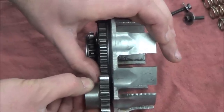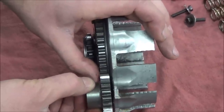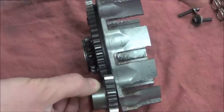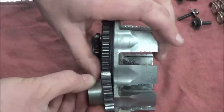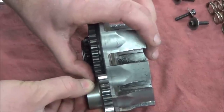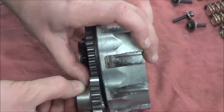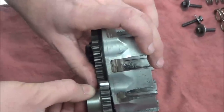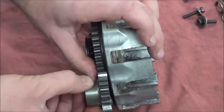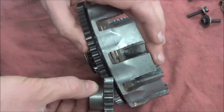Yep. Okay, so as we move into transmissions and you guys are going to be shifting those transmissions on a bench and engaging a gear set for first or second or third, you need full contact. If you just give me something like this or something like this, you understand that that is incorrect. You with me? Would a worn shift fork create one of these conditions? Yes. Yeah, absolutely. So our best friend is just go to microfiche and find out whether we actually need something or not. Make sense?